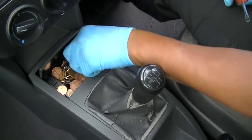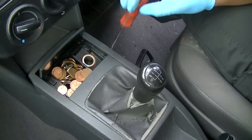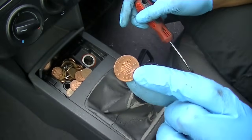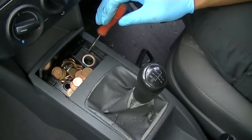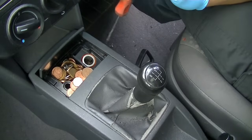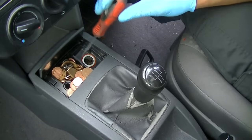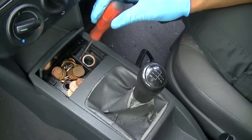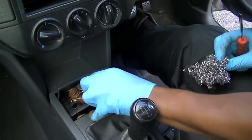The reason this happens is because if your lighter setup has change in it, a 1p coin falls inside and short circuits the lighter itself, blowing a fuse. I would say 95% of the time that is the cause of the problem. So remove your change from that area and avoid short circuiting it every two minutes.